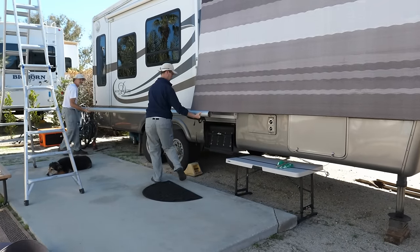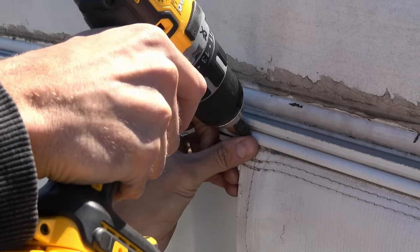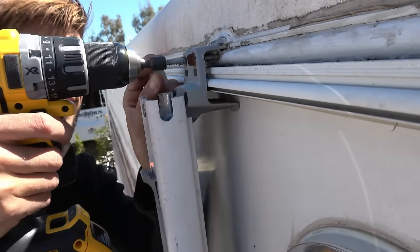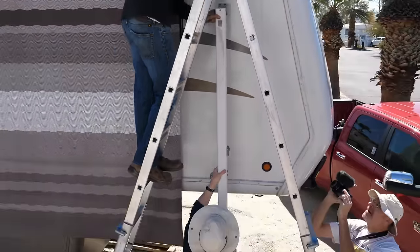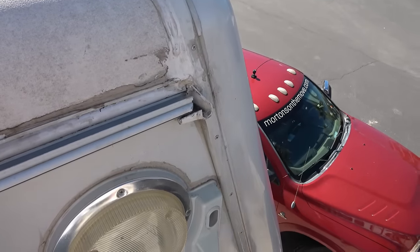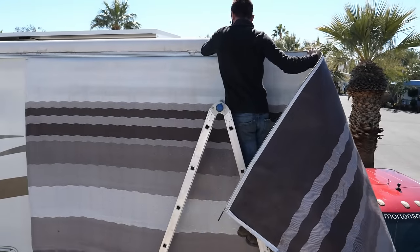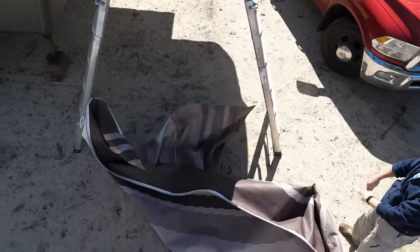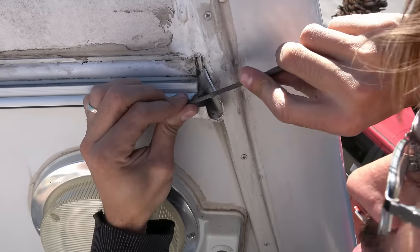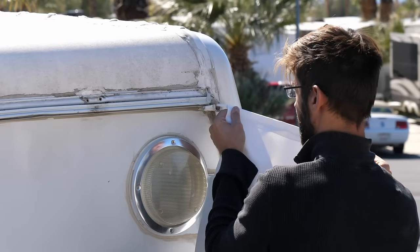With the tube off, we removed the fabric from the RV. We located the securing screw that prevents the fabric from shifting in the track and removed it. In our case the fabric could only be removed in the forward direction, so we had to remove one awning arm — by removing two bolts holding it to the RV and disconnecting it from the lower bracket. We also removed obstacles like gutter spouts that could interfere. Then we slid the fabric out of the track by pulling hand over hand, and it slid out very easily. To assist with installation of the new fabric, we widened the end of the track with a screwdriver, filed it smooth, and sprayed the track with silicone spray to lubricate it. Then we fed the new fabric's bead into the track and slid it to the approximate position.